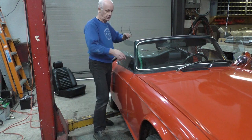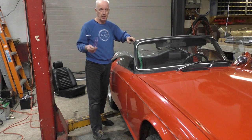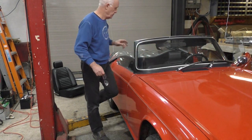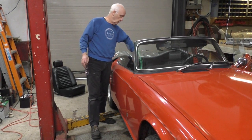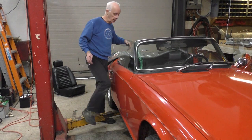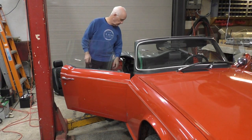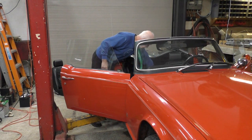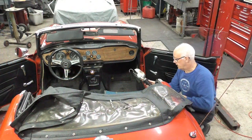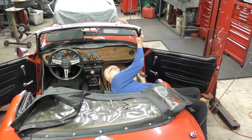Now I can get underneath the footwell a lot easier with the seats out — it's only two bolts. What I did was go outside to another TR6 waiting to be repaired, flip the hood, and measure where I'd want the holes, marking them on the inside of the firewall so I know where to drill from inside. I'll put all the measurements in the video later. The only uncomfortable thing is the sill frame, so I'm going to put something there to protect myself. Now I'm going to get underneath, check my measurements, and mark my spot for drilling.